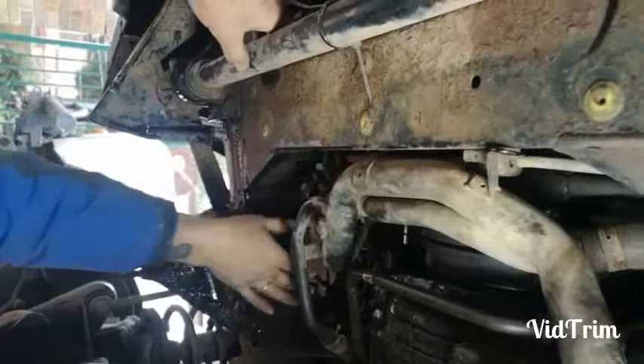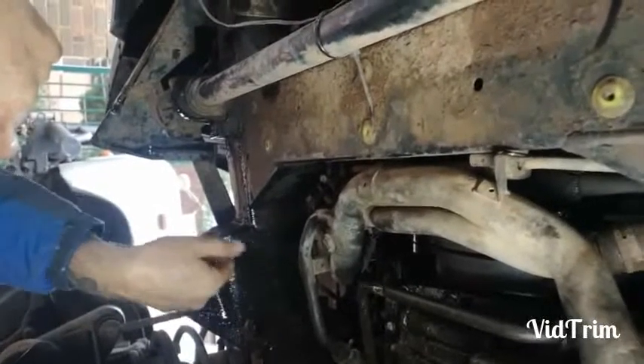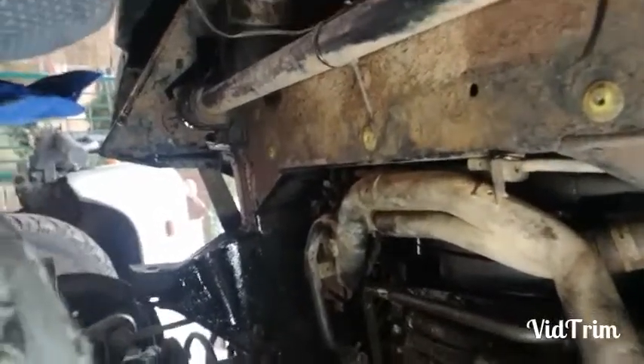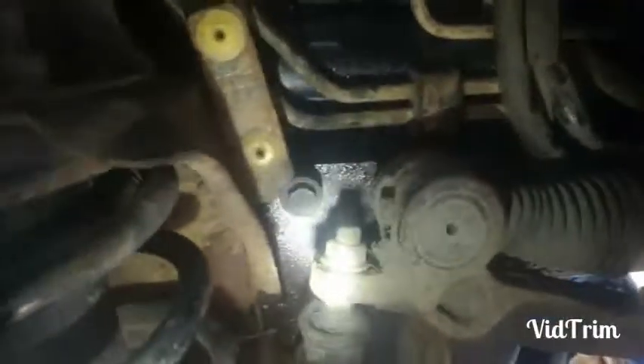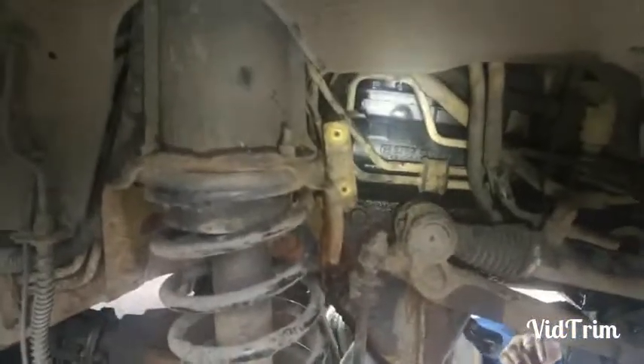The new box has got to go up onto there with that knuckle up there. We'll put it up, rest it on the chassis, then join the steering wheel to it with the universal joint. Hold it there and I'll go around the other side and put the four bolts in, then jemmy these pipes over to the left to make room. We got it in position - jemmied the pipes out, pushed it into position and it sat really easy. We lined the bolts up, used the torch to see the holes and put two bolts in to keep it in place. Now we'll bolt that down, put those two pipes into the top, tighten everything else up, reconnect the steering wheel and we should be done.